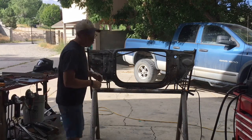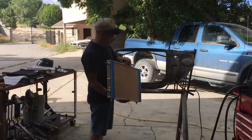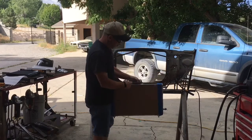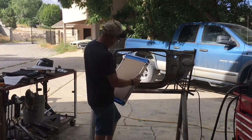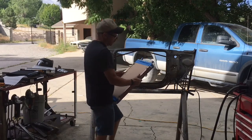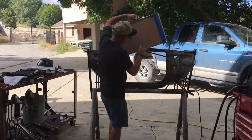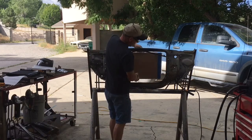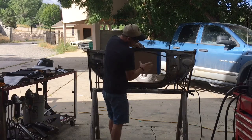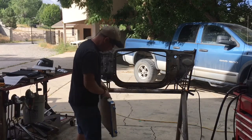I'm going to grab them real quick - the design on the radiator. This is their intercooler for the supercharger, and the design is going to be somewhat similar. We're going to have a couple of posts up here, a removable plate, same kind of thing on the bottom with pins. The radiator is going to have that, so that's why we're deleting these bolt holes. This will most likely need to mount on this side, and then the radiator on the inside, basically just sandwiched right up against each other.